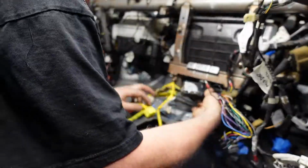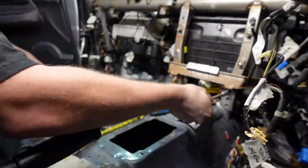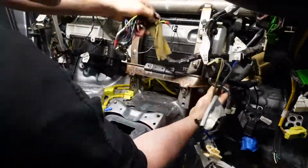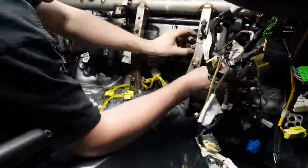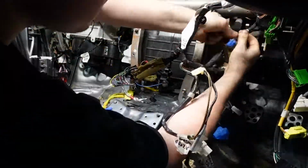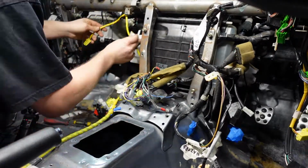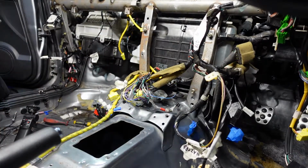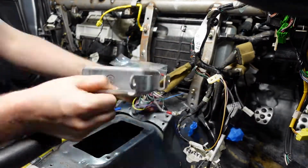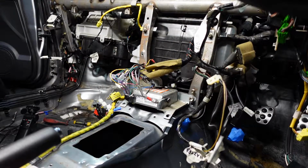So my process was, when I took apart a connector, I labelled both the connector and the wiring associated to it. When laying out the wiring in the car, it's easiest to just try lay out everything in its relative spot. On most of the connectors, I labelled them with a little code. I used the code PASS or DRIV, which stood for passenger side or driver's side. This meant that I could easily determine what side of the car the wiring goes, and as all the wiring kind of flows together, it was easy to route everything into the right place.